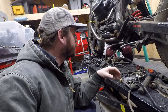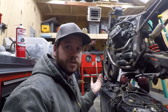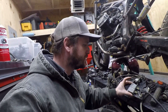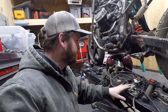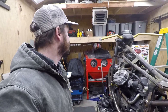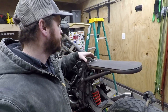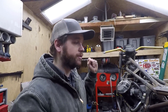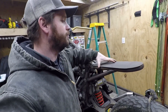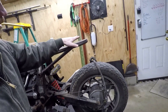It's still going to have turn signals — bar-end turn signals — plus high/low beam, horn, just what it has to have, kept simple. I'm planning on using the stock TI ignition with the transistors, and the stock GL650 linkage. I did already start roughing out a seat pan — I'll link the CX build where I show how I build seat pans using 14-gauge steel. This one is going to have a shape that tapers up a little from the side and is kind of crowned in the middle, almost like a motocross bike.